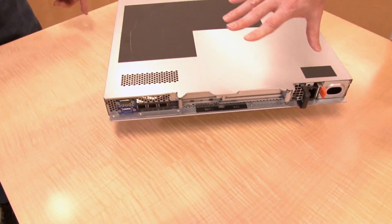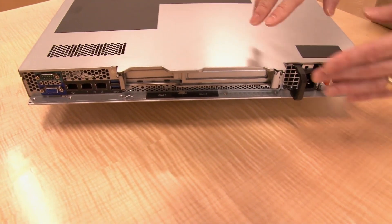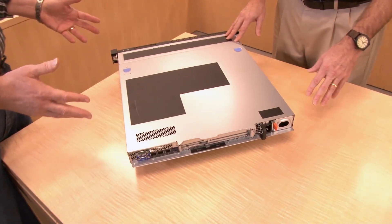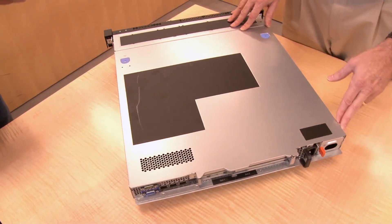Looking at the rear — it's a usual rack configuration. Unlike the X3250, this system actually supports three PCI slots: two external and one internal, which is for an internal RAID card. On the X3250, when a customer plugged in the internal RAID card, they lost a PCI slot, so we found room in this system to add a dedicated internal slot. Also, this system is about four inches shorter than the last one, which addresses customers who wanted a shorter-depth system for a smaller rack or space-constrained environments.